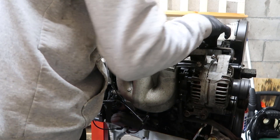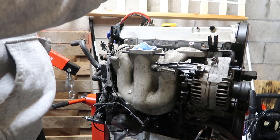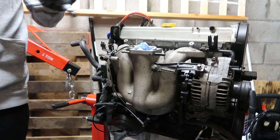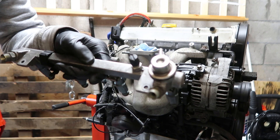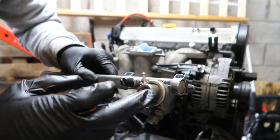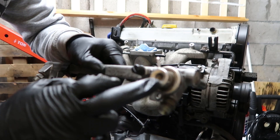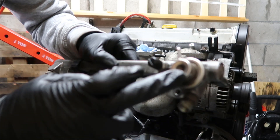The fuel rail is already loose, and I'm going to be changing the fuel pressure regulator out for a 3.5 bar from the 3 bar standard — just a little bit more fuel, and plus it's obviously really old.